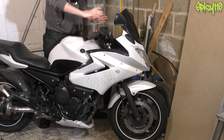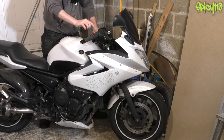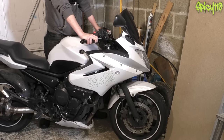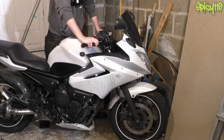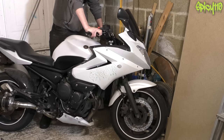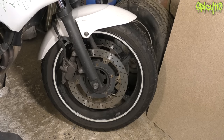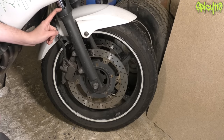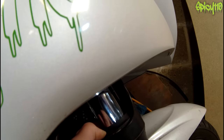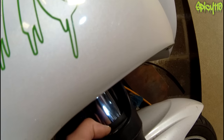At the same time you're checking the front suspension — make sure it has resistance and controlled dampening and isn't pogo-ing around. You can see it going down with resistance and coming back up in a controlled manner, which is good. Before moving to the bottom front of the bike, also check the fork seals — make sure they're clean, no oil everywhere, no rust or damage, and the dust covers aren't perished.